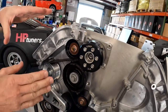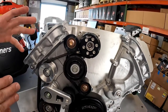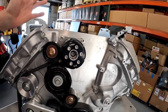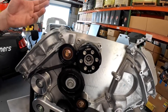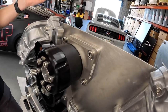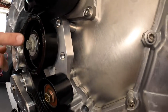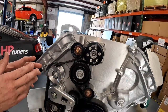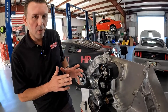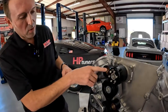I call this the Predator Claw bracket because it is all about gripping the belt. Our take on it is a little bit different — there are products out there like this, but they attach to the supercharger nose drive. I made ours differently so the customer has flexibility in the supercharger they run. Our upcoming upgrade for the predator doesn't have the same bolt pattern, so we couldn't attach there — we had to attach to the front cover. This big idler that Ford puts there from the factory is kind of odd. It is not how really any other supercharger system is routed, and Ford never really designed the system to have a smaller pulley put on it because it comes with a three-inch from the factory. Once you start going smaller, the belt wrap goes to hell until you add one of these idlers up here.